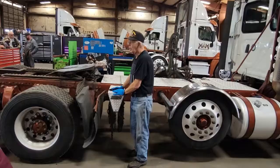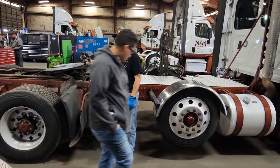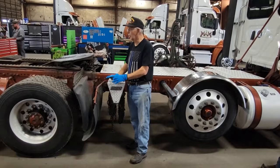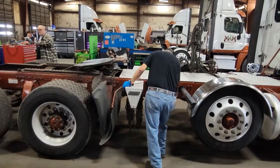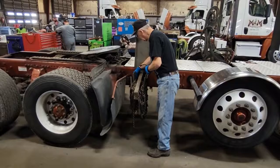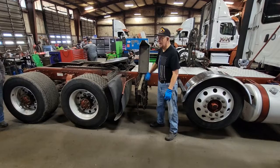Any questions about the safety stuff? If you get out of the truck at Longview and there's a padlock on the chain box, it always has to be cut. Some people put wire ties through there — if you don't have a knife, you can't get it out. Another reason to really inspect your truck. Also, if you just ran ten miles in slush and snow, you can't get the chain hooks off. I've seen guys with hammers beating on them — I just take the de-icer, wait about 30 seconds, and they come right off.